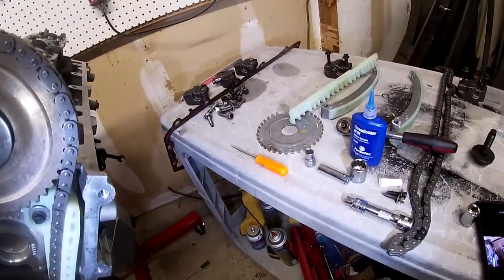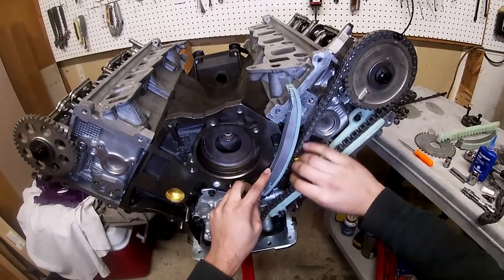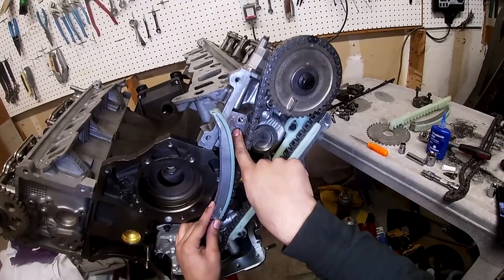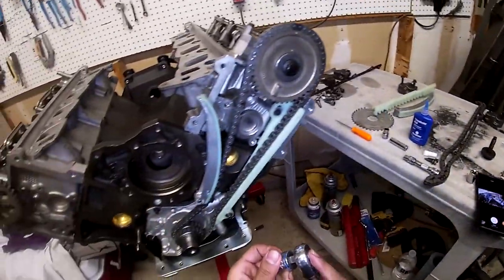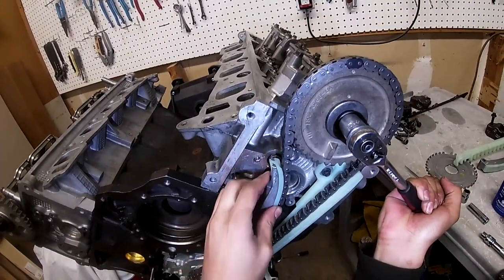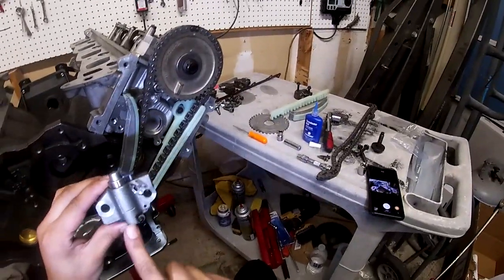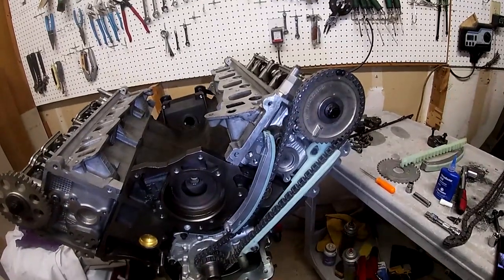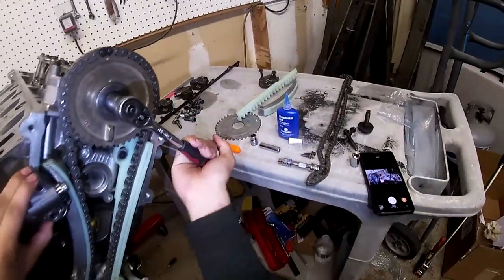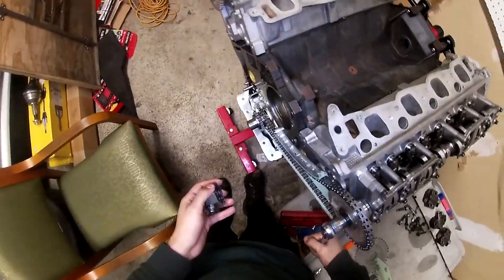Now I'll put on the next guide — there's a little pin here, so slide the guide on top of the pin and make sure the chain is in the middle. The tensioner goes right here, but since we don't have space I'm going to turn the cam gear up just a little bit to create some room. I'll have to hold the guide while I install the tensioner. The timing chain tensioners are marked L and R for left and right, so I have my left-hand side tensioner ready.